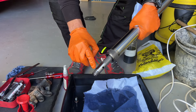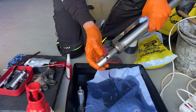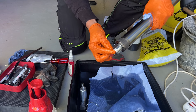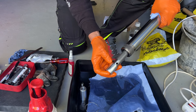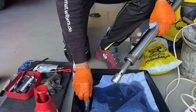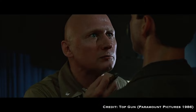We needed to get the correct original stock twin cam Rushmore parts, which took quite a while. These are the correct parts — and you can see they are not blocking the oil passage. It's important that you get exactly the correct oil stops for the fork tubes, because this cone-shaped top fits exactly into the fork tube. Milwaukee 8 oil stops look almost the same but have a different cone shape, which will mechanically block the whole fork assembly. Now we have the correct parts and will assemble everything back with the correct oil level and oil.